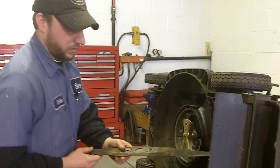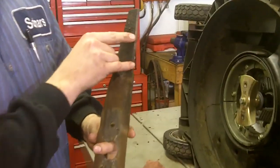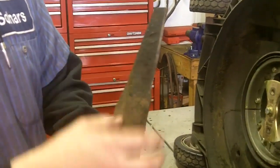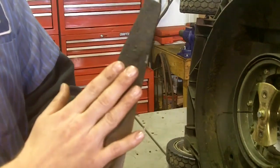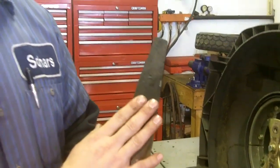When you go to sharpen your lawn mower blade, you can see there are two sides: your cutting edge on one side and your flat edge, which is typically towards the ground. Always remember which way you took the blades off — you do not want to put them upside down or the quality of your cut will be diminished significantly. Always remember which way your blades need to be indexed.